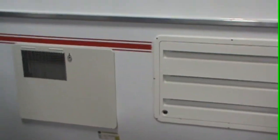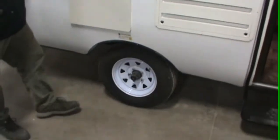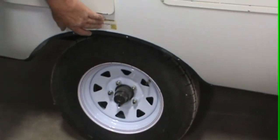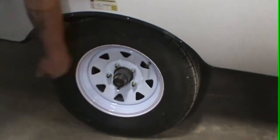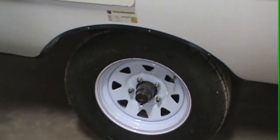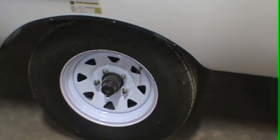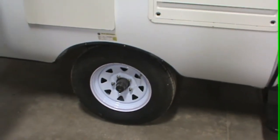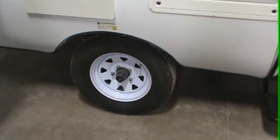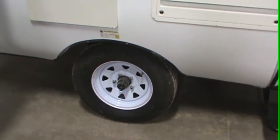We test our water lines with air pressure. Now we're on a 13-inch tire — it is a D-rated tire, so the air pressure is at 68 pounds. On the sticker down here there's a little rubber center cap that pops out. Every five to six thousand miles they recommend greasing it — just put a grease gun on it, two or three squirts. At least once a year you have to do that. Between 10,000 and 12,000 miles or every two years they recommend pulling the whole hub assembly apart, clean up your bearings, hand-pack, and put them back together.